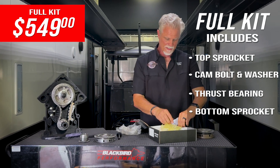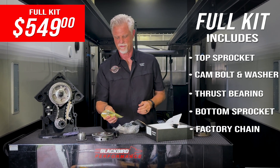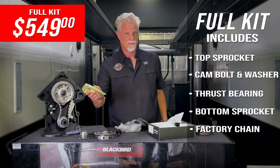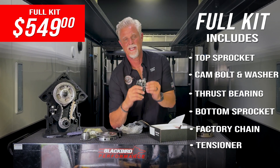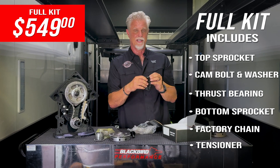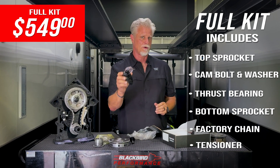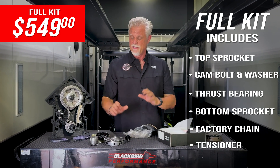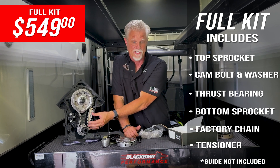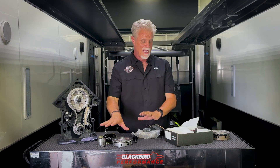The nine-position lower sprocket comes as part of the kit. In addition, we give you the stock brand-new OEM timing chain, sourced directly from the same source as the OE chain — it's the same timing chain you'd get in a new stock timing chain system. We also provide a tensioner — that's the part that pushes on the chain to keep the tension in it. It does wear and has a spring in it riding hard against the chain, so in many cases people want to replace it and we offer it as part of our kit. We do not include the guide as part of the kit; the guide is an optional add-on.